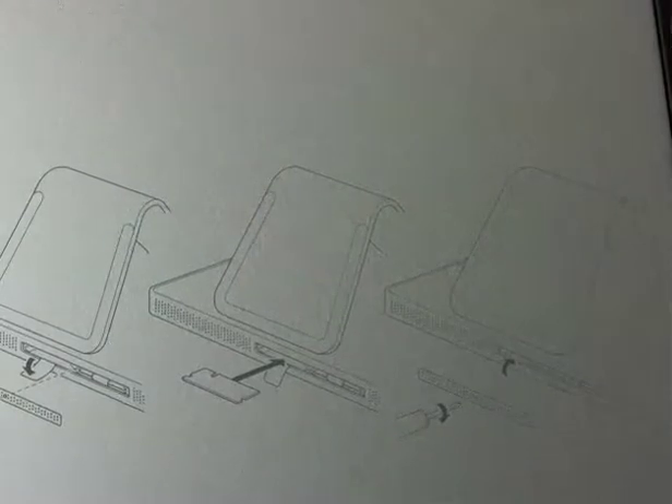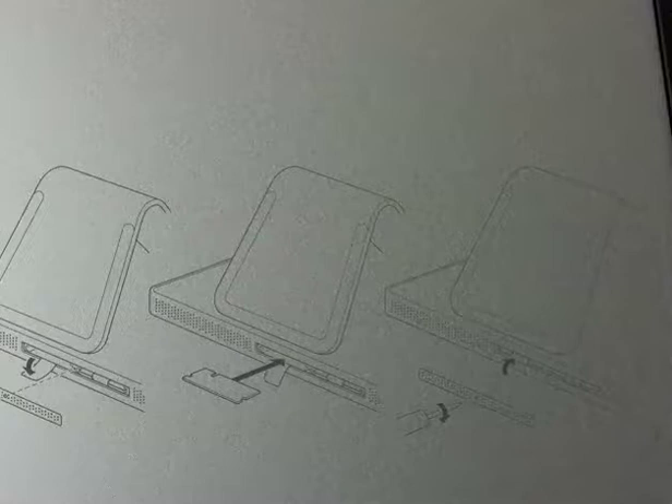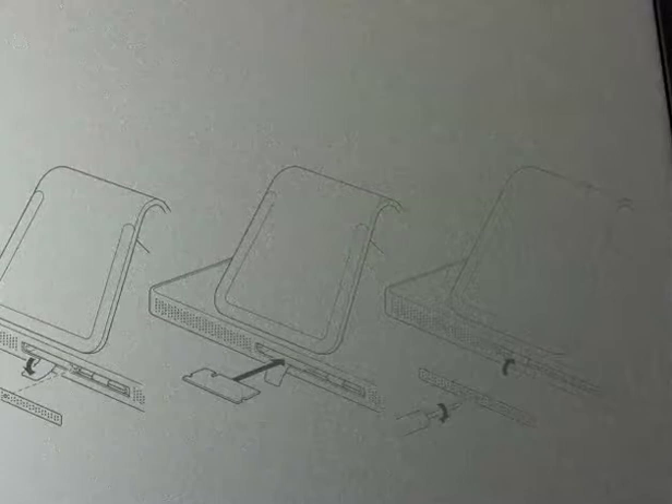The first thing you need to do is remove an aluminum plate that has one Phillips screw securing that cover over the memory slots, then remove a little flip lever of plastic that's in the way — that's used to remove an existing piece of memory, and I'll demonstrate that also. Install the new memory, and then reattach the aluminum plate.